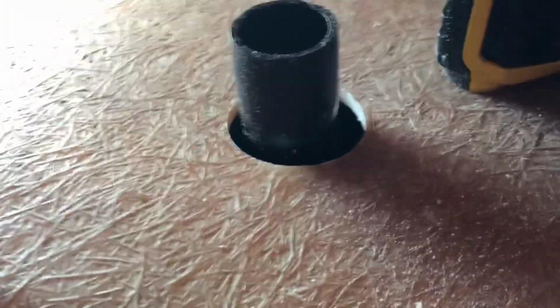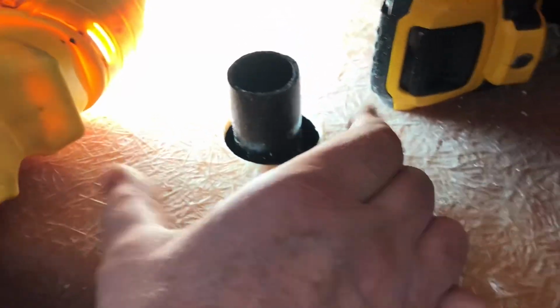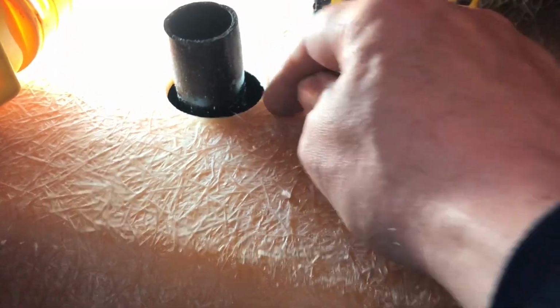Now for this one here, I can see why they wanted the 2 1/4 inch hole, because the mounting is really hard to see. The mounting bolt is even with the floor. So if it was bigger, I'll be able to get the bolt through. I'm going to leave it like this. What I think I'm going to do is cut a little keyway here and a little keyway there to get the bolt in. Over here, it doesn't really matter because the bolt is way down there and it's much more easily accessible through the wheel well. Sorry, that's kind of dark, but you get the idea.